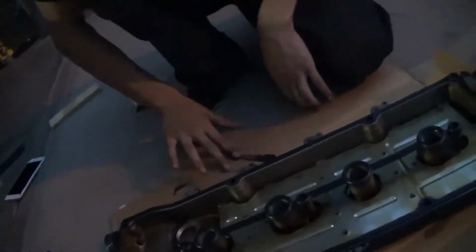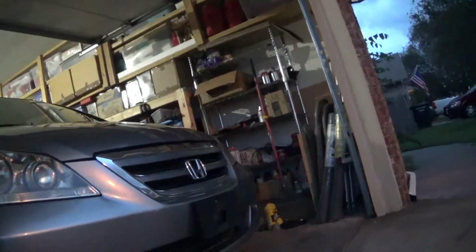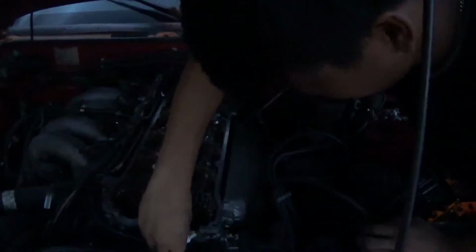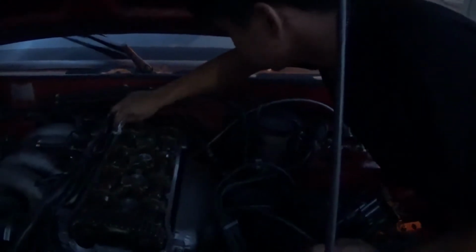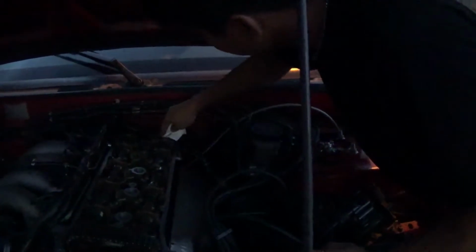If you get some on the other parts, I don't think it really matters because it's a gasket. Alright, now before that dries up, we gotta go over there and clean that mating surface. Alright, come follow me. More brake cleaner. Brake cleaner is good. Spray some on there. Go on this mating surface and go all the way around one last time. I already did it before, but yeah. Just gotta make sure these cam caps, I don't even know if they're called cam caps, that's what we call them in the other terms, but those things, make sure they're super clean because that's where they like to leak from. And I don't know why they made it like that.